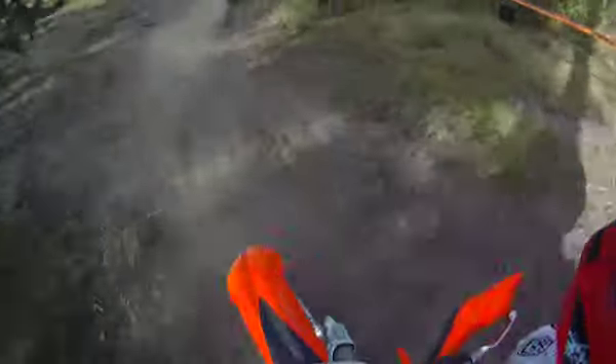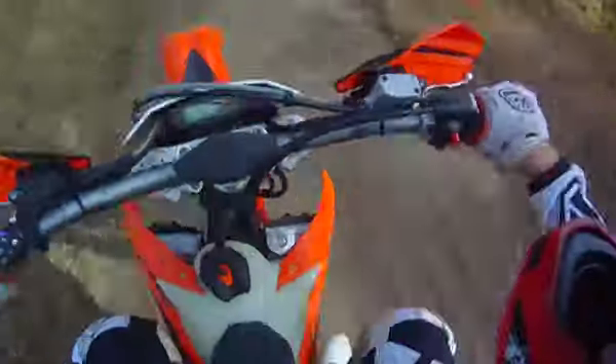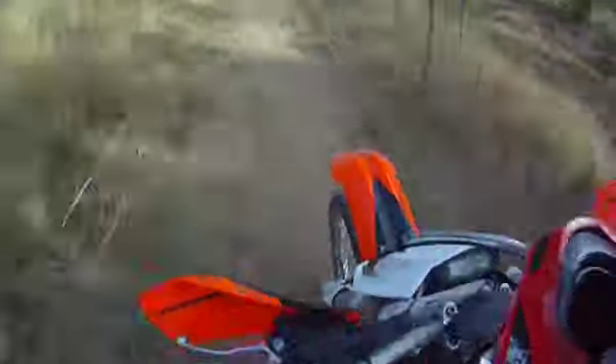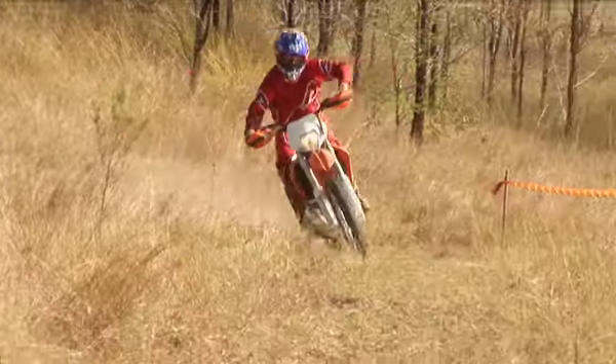The beauty of this is that when you pull the clutch in, it gets lighter as it comes to your hand and heavier as it goes out to the extension. Also, as the clutch plates wear, there remains tension on the plates all the time, so there's no slippage when the plates start wearing out. It's actually simpler and very good. It was all designed to simplify the bike.